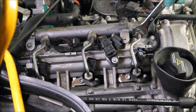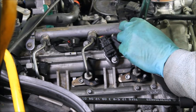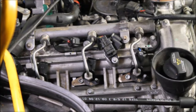The final thing I'd suggest is that when you're ready to start the car, turn the key to the ignition position 2 and you'll hear the diesel pump run — you'll probably also hear the air that's in the system going back to the fuel tank. If you do this a couple of times before you're ready to start the engine, it should start very promptly.